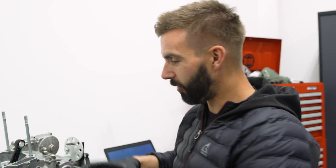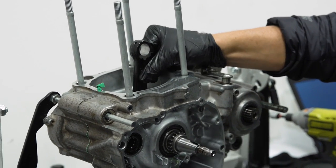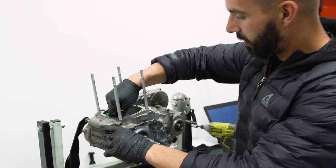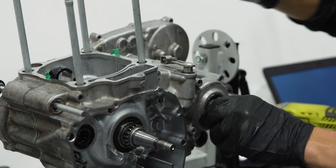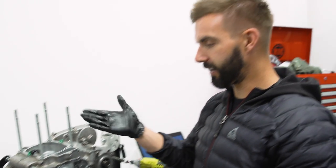What's your role in this whole thing? Supervision. He is, because I'll be the first to admit I'm not very mechanically inclined. As far as tearing down a motor and completely rebuilding it, there's no way I'd feel confident doing it on my own, so Charles has been supervising me but making me do the dirty work — which is good because I love learning about engines. We got the cases back together and the new crank is installed. With the new crank there's no up and down play. You want to make sure the crank can rotate freely and that the transmission spins freely — if it doesn't, something's not right and you'll have to pull the cases back apart.